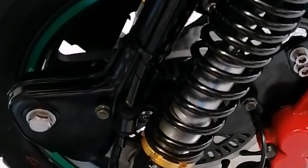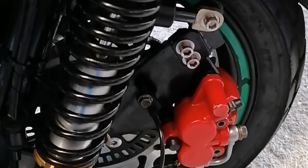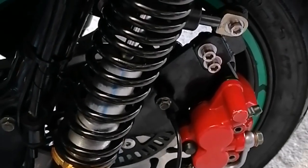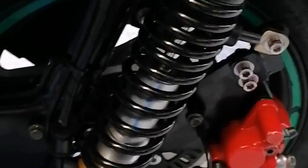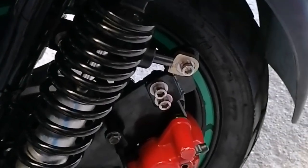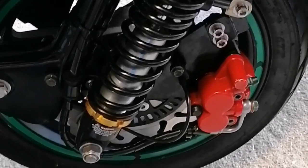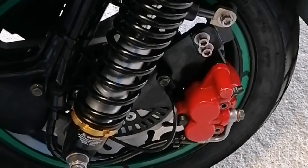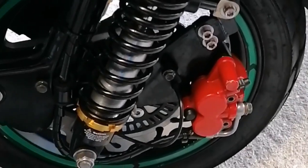Spend five minutes going around everything, wheels, nuts and bolts, anything you can see, just have a little nip on it, see if that'll go a little bit tighter. And also, I pumped my tyres up at the beginning of the summer and they were 16 psi when I went to test them, so keep an eye on your tyre pressures, boys and girls, because it makes a hell of a difference. I put 28 front, 32 rear. That works for me because I'm 18 stone, so I don't want to be bouncing about like I'm on a bloody space hopper.